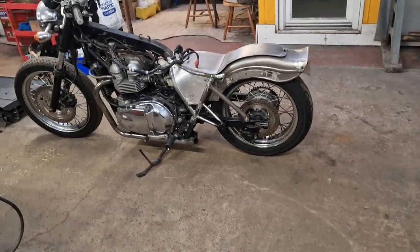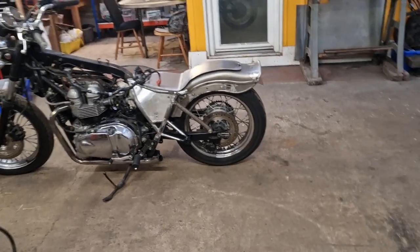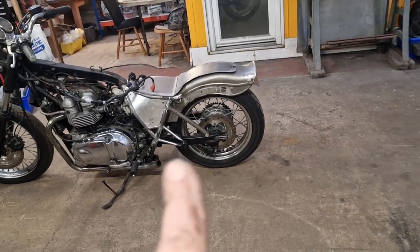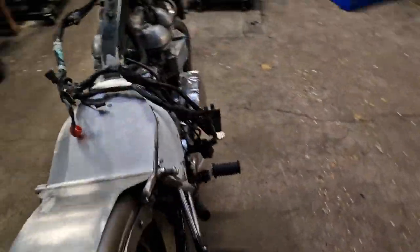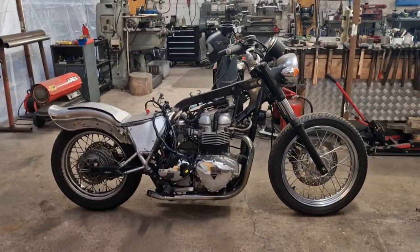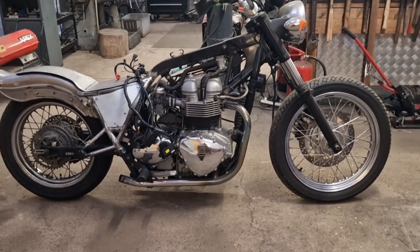Proper out of breath. Just took the bottles back, quite heavy. But there it is, in all its glory. Like I say, Todd might want to go slightly longer on the back shockers. That bar I've put in is 11.5 inches. Go 12.5 inches, you'll have an inch higher. Won't hurt, although I quite like how it sits. But that's not my call. It's up to the man himself. But that's job done. Finished. Sorted. There you go. Quite the epic endeavour, didn't it?